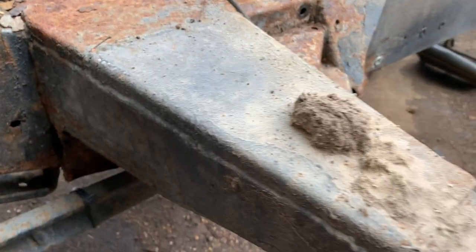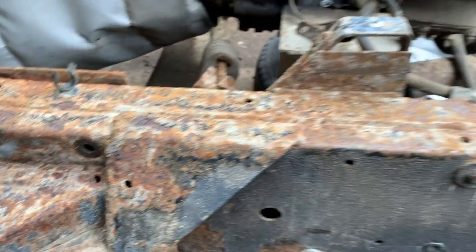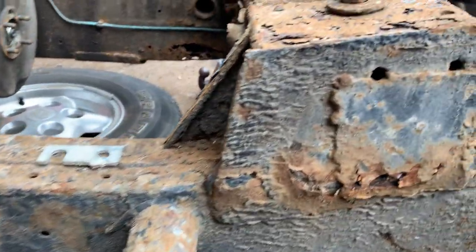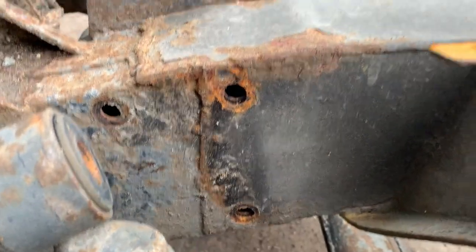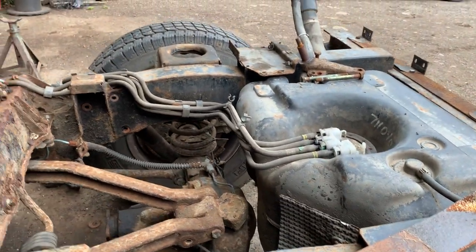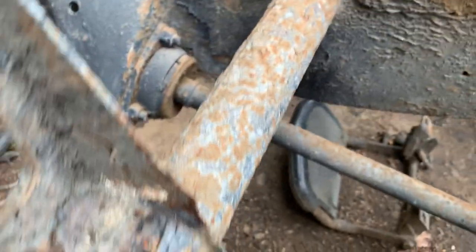This outrigger has been replaced and isn't in too bad a shape. But when you get down to the back end where the rear tub is held on, it's just awful — all the way around here. It's had a rear crossmember with extensions put on not that long ago, so the back end's actually not bad at all — it's almost worth cutting the back end off, but we won't. The outrigger here is rotten as a pear, and you can't really see that when the body's on because it sits on top of it.